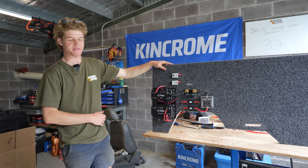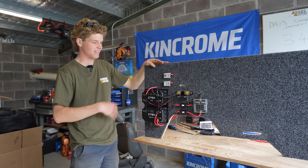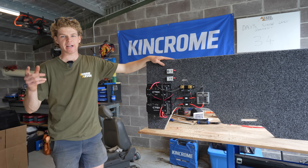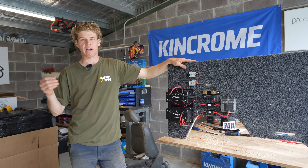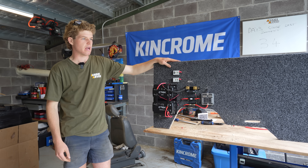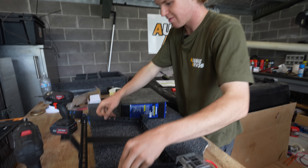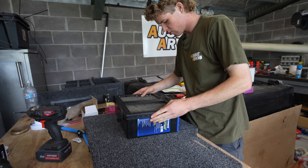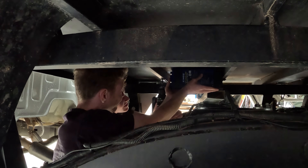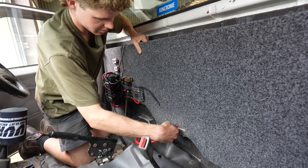We've got the board wired up and I'm super stoked with how it turned out. There are a lot of cables to run so you can only make it so neat, but I think we've done pretty well. The next step is to get the battery mounted up under the tray so we can start working out our cable lengths from both the starter and secondary battery into the panel. We placed the battery into its new battery tray, making sure to use rubber sheets on the top and bottom to dampen vibration and prevent wear, then secured it under the tray. We then ran the cables from the battery through a grommet in the cab and behind the 12-volt board to be terminated at the chargers.